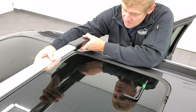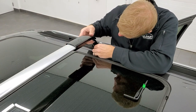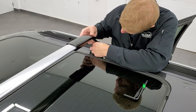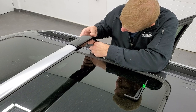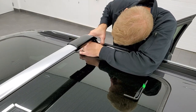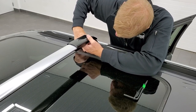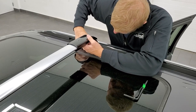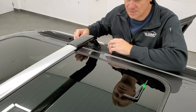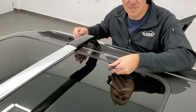Get it into place and set it up. You're not going to want to use the torque wrench right away — just get the bolts started. With metric bolts, always get it nice and straight so they thread properly. It's always a little tricky getting them to thread. Once you've got both of them threaded, do the other side, then use the torque wrench to torque it down a little bit and you should be good to go.